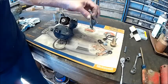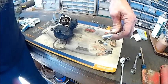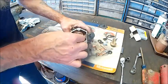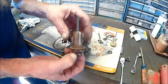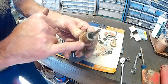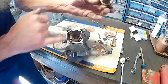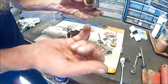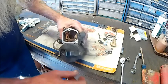Taking the cover off is no big deal — it's just three little screws, size 9/32nds, and then you get in there. This is the internal — the plunger with a spring. As you can see, the contacts are very burned and very pitted. There's so much damage that taking it apart just to sand it down doesn't help. This is what I did last time — I just sanded it all down — and you can see the powder burns on it. These are the two contacts internally that are going to be replaced.